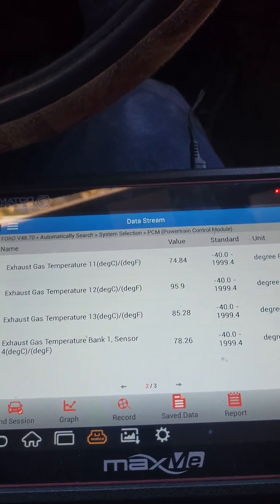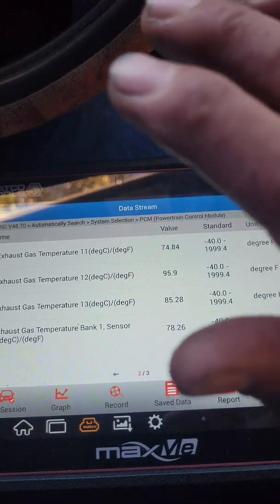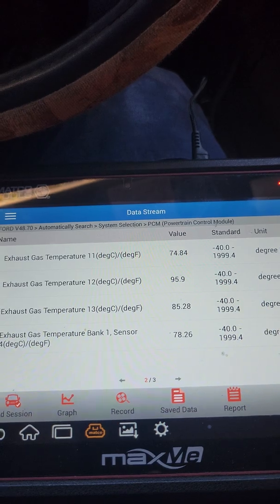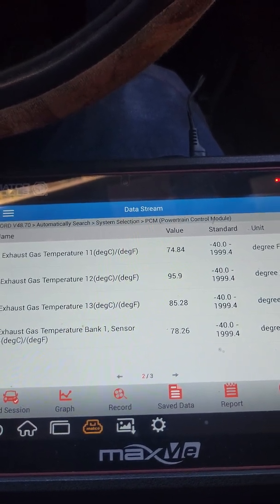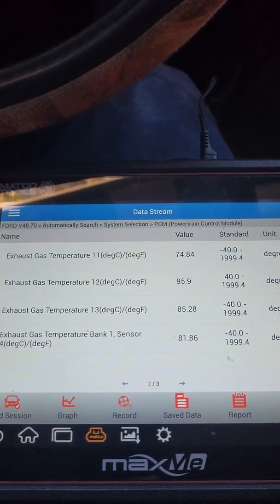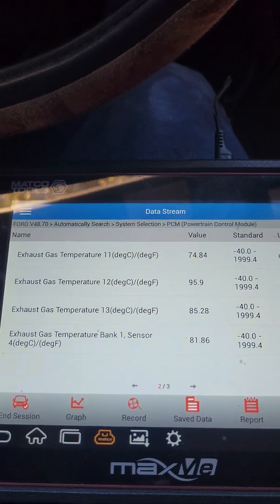And this is the only procedure to be able to unlock it, even if there's no check engine light, even though there's no sensor codes coming on. The only other thing that can be fooling us is an exhaust leak. I don't see an exhaust leak, but we're going to see what's going on right now. I'm going to do this first before going in there and getting into that turbo or exhaust system to see if there's a leak, since that seems to be a harder job than doing this.